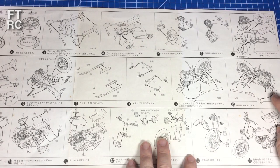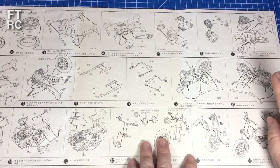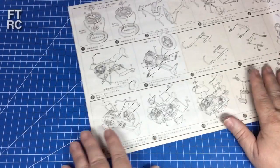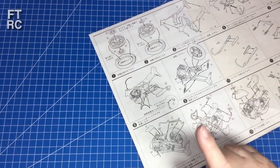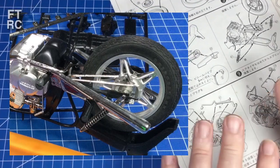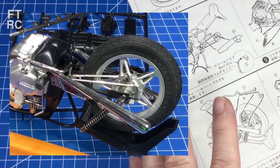They sit fine. The only thing you've got to do is make sure you space them out. Now, when you put your pipes on, immediately, do not pass go, go straight to jail, that sort of thing. Go to this part here, 21, okay? Because I would have normally put my chrome pipes on, well, instructed Bass to do it.